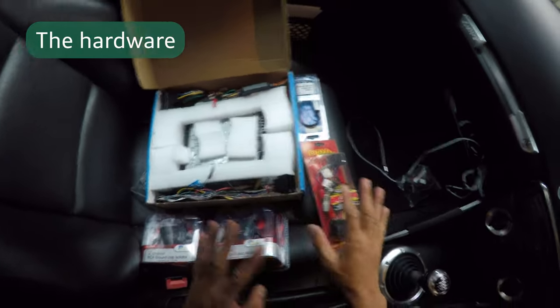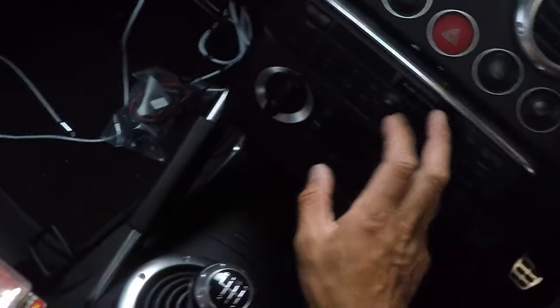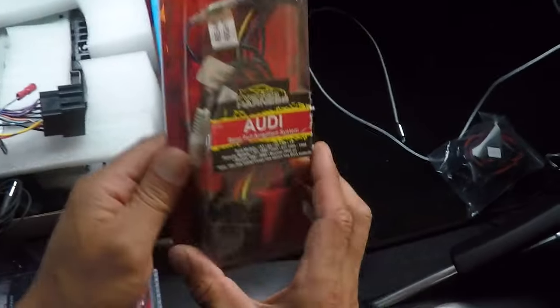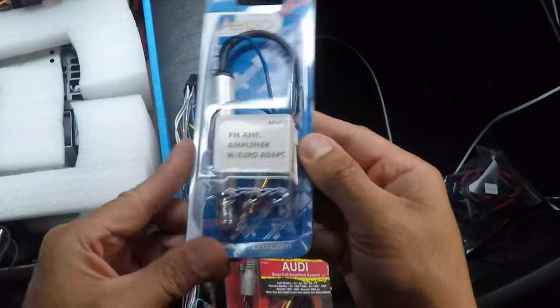So what have we got here? Obviously there is the stereo, and then I've got a few different wiring looms. This one I've adapted to plug into the stereo, and then I'll plug the head unit's plugs into these two for power and the speaker out. I don't think I will plug that one in because I'll need this adapter here — the red one — to convert the signal from the amp to these RCAs so I can plug them into the stereo. I've also got the antenna lead with the blue signal for the powered antenna, and some ground loop isolators because in past experience I would get a little pop whenever I turn the stereo on.